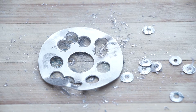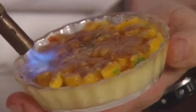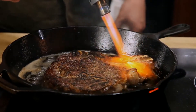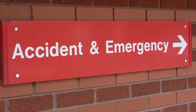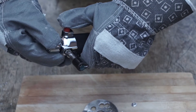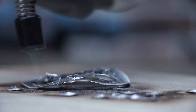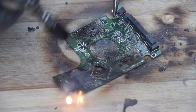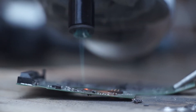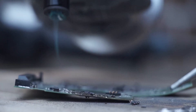The platter is now well and truly mangled, but we are going to keep going. The next stage of the physical destruction is to use a blowtorch to expose the platter to high temperatures and to burn components on the circuit board. We are using a cook's blowtorch, used to brown crème brûlées and to sear steaks, and available from kitchen appliance stores. A blowtorch is potentially extremely dangerous, so don't try this at home. We light up the blowtorch and direct the flame over the scored surface of the platter, moving it slowly and lingering over each inch of the surface area, ensuring that every bit of the platter is exposed to a high temperature. We now use the blowtorch to burn the surface of the circuit board, passing it over each of the components slowly and allowing it to combust. We are doing this in a ventilated area and using a face mask to avoid inhaling the fumes. Inhaling the fumes from combusting components is dangerous.